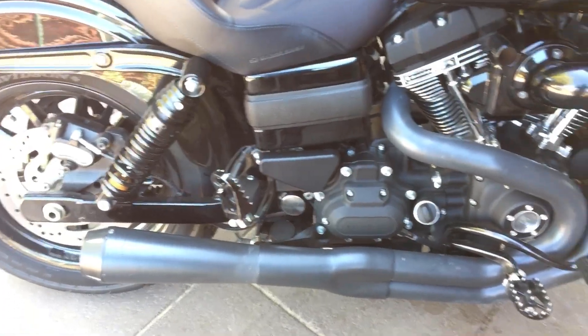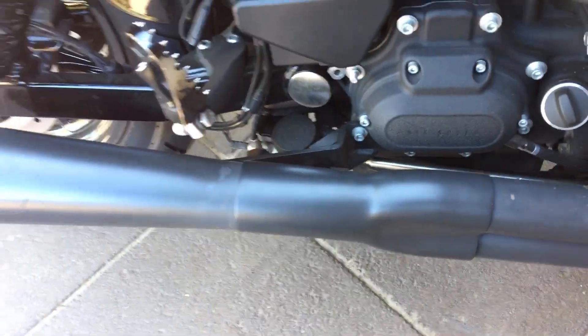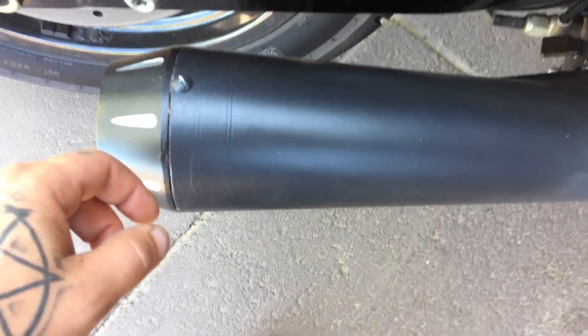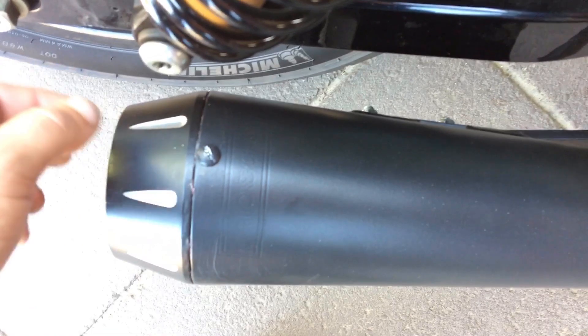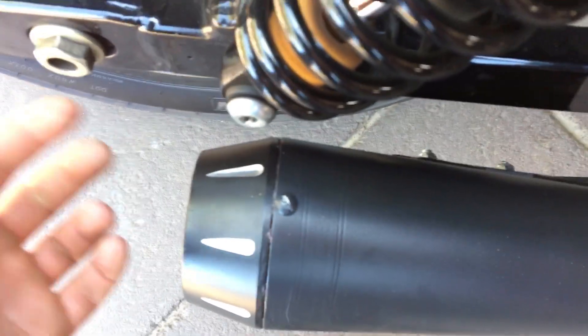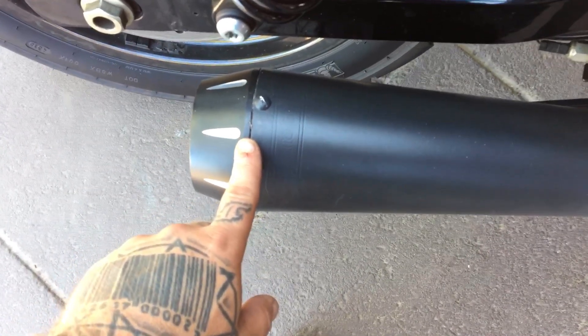What I did is basically cut it all off except for that end cap right there, which actually keeps a lot of the performance. Before I did that, I just had the Thunder Monster baffle itself in there and it was just obnoxiously loud — like, embarrassingly loud, way too ridiculous. So I changed it. Now it's just got one right in here, and it still had so much back pressure that I actually had to drill another hole in the muffler and add another bolt because it would just slide off the back.